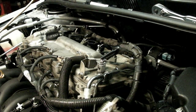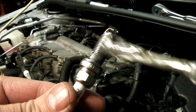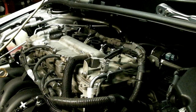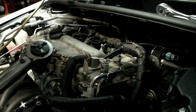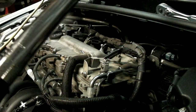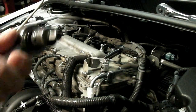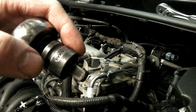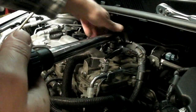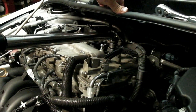Here's what I'm going to do. I'm going to put just a little touch of anti-seize on these bottom threads here, so next time I take these plugs out it'll be all good. Once you've got your spark plug threaded down in the hole pretty good, you're going to take your torque wrench and set it for 15 to 20 foot-pounds — I set mine to 15. I've got a half inch to three-eighths adapter on there, and we're going to torque this spark plug down. There it is at 15.